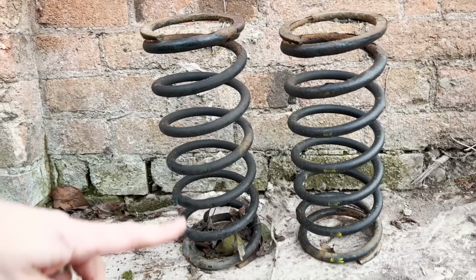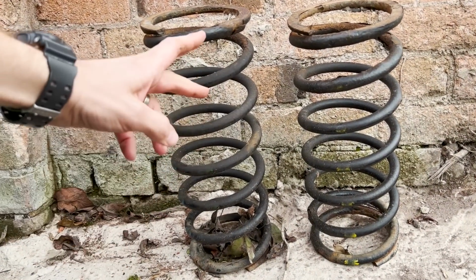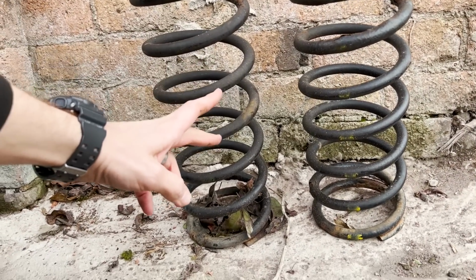So before we begin and take a look outside my car, talk about those differences and look at the setup on my truck, let's talk a bit more about springs, because there's a lot about suspension in general I didn't realise. So the springs that came off my Defender were linear springs, and linear springs mean that the distance between the coils is equal. And what it means is you've got one type of spring rate. So it means that 100 kilos compresses it, let's say, an inch, another 100 kilos would compress it another inch, another 100 kilos would compress it another inch. These are my old springs, as you can see, and they have that linear pattern, so each one is the same distance. And that's okay if you're trying to achieve one specific thing, so handling or comfort.